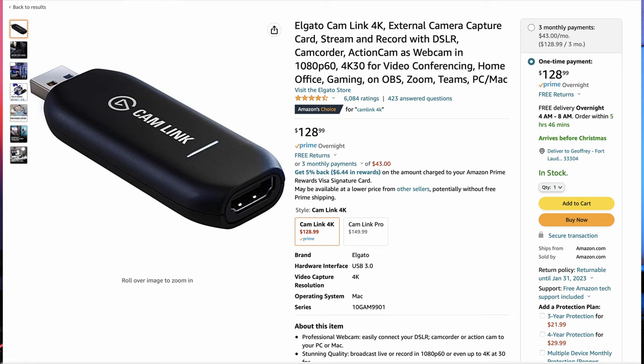You want a clean feed, and by turning off the HDMI info display you'll also be able to see the LCD screen on your camera in addition to outputting via HDMI. If you don't, it's going to output everything over the HDMI. The next step involves unfortunately two pieces of external equipment — an HDMI cord and a capture card. If you're going to be streaming with just one camera, I recommend getting a small capture card like the Elgato Cam Link 4K — it's just a little USB dongle that also functions as an HDMI capture card.